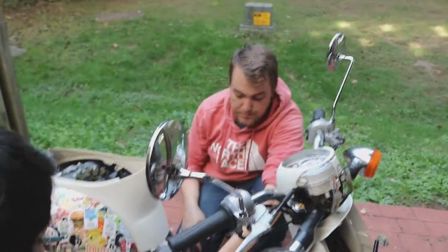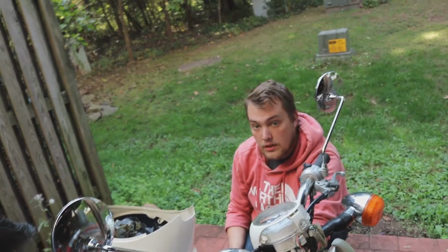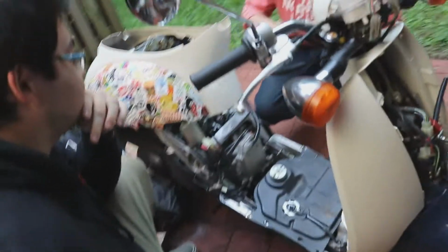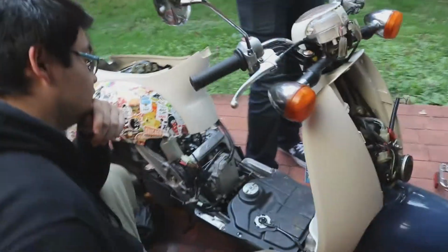So that's barely holding on to the barrel of the pump. But it's also not leaking. So tight enough that it's doing a job. Yeah, it's doing its job. You know what it probably is? Bumps on the road and stuff like that. It's gonna slowly... You know what it probably is? It's probably the wrong gauge hose. Maybe. It's probably too thick for it. Yeah, the wall is too thick.